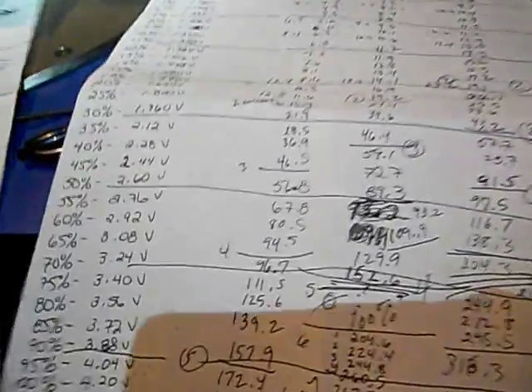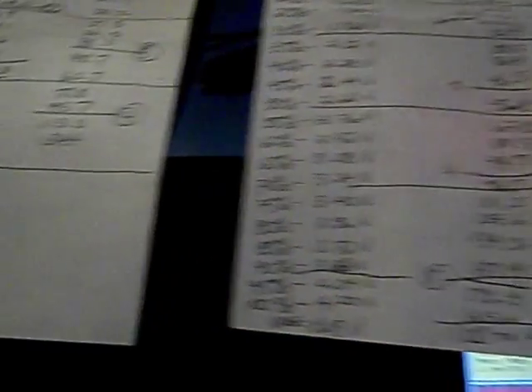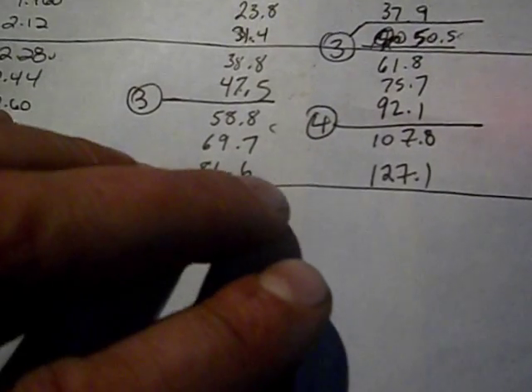What it taught me was that there's something called helpful turbulence — beneficial turbulence. What I wanted to find out on this test was what kind of helpful turbulence the groove could add, even once you're so far past it that logic and reasoning says it shouldn't be doing anything. What we are finding is that we're getting up into throttle angles — like right here at 50% throttle angle. That's the TPS voltage that equates to it, and we have three columns: testing at 10 inches, 25 inches, and 40 inches water column pressure.